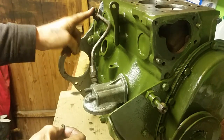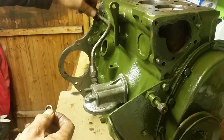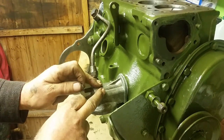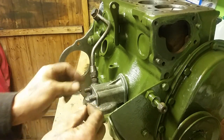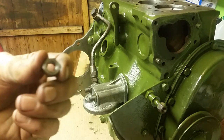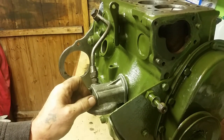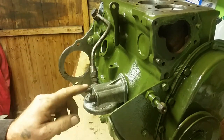I just wanted to show you: we did the banjo nut finger tight and I can undo it again, so I know it's threaded perfectly. The housing already has the gasket on - I can mount and tighten it to the specific settings since it doesn't need to come off anymore. You need your spring washer on each stud. Check your nuts - you can often see which way they came off and they'll go back on that way. Put them back the same way they came off and they'll go on easily.